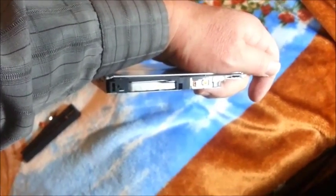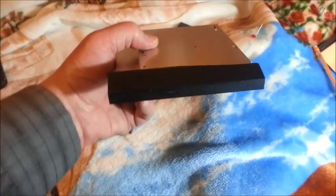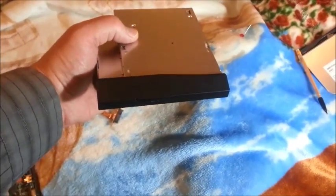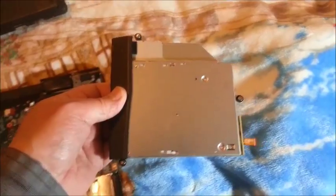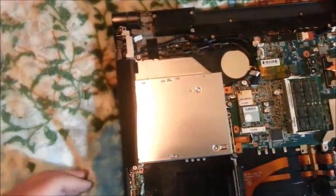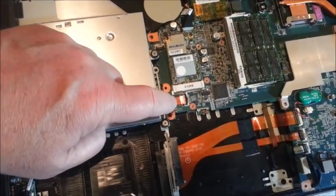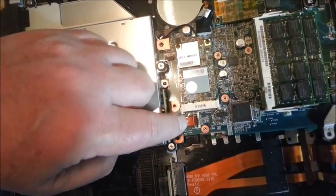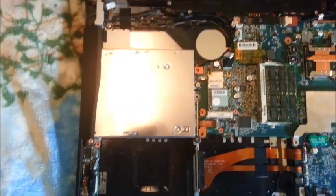So you just do this in reverse — swap the trim, put it back on, and put it back in. I got the trim back on; it snapped on really easy. I did open the drive before I attempted that — made it a lot easier. Okay, it's back together. The drive is back in — went together really quick, very easy. Now we need to insert this ribbon cable. Get it to the correct length — you can see that little line right there — and then flip the little plastic piece down. Click — it's in there. Blu-ray is done.